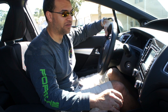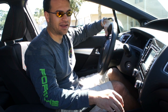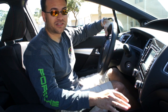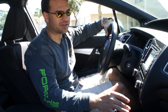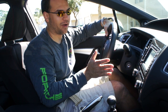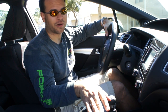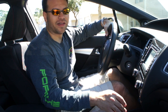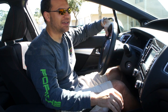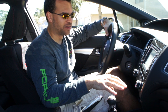Why do we do it? Believe it or not, it's not so much to help slow the car down when you're braking as it is to get the car into the next gear at the RPM you want it without jerking the tires. Especially on a rear wheel drive car. Now I know this video is more for Honda Civics where it's front wheel drive, but the worst thing you can do is snatch the car and get the back end to start coming around. In a Civic it's going to be the front end that gets squirrely, but that's still going to mess you up as you transition into a turn. I like to say to students on racetracks that the car can do a lot more than you think if you ask nicely — it's when you start demanding stuff that it gets upset. So the goal is to do everything as absolutely smoothly as possible.